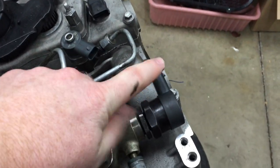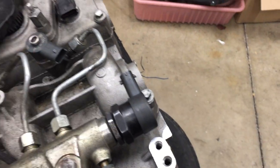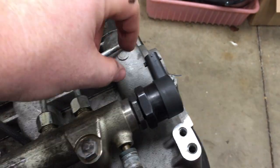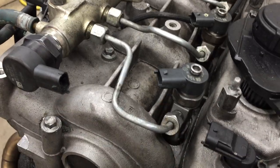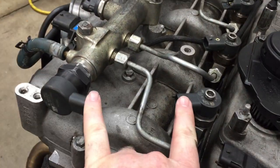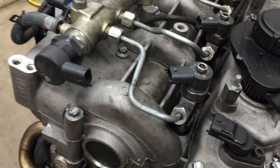It's also really easy to swap the electrical plug for this regulator and injector number four because they have the exact same three pins. There's a little tag that says what each one is, but that little flag thing falls off. So it's possible to switch this and injector number four together because they look identical and are right next to each other. If you just did a bunch of work and it's not starting, you might have swapped these two.